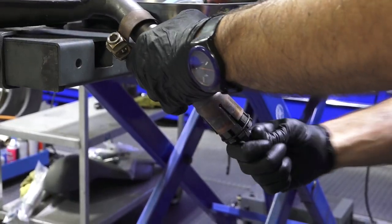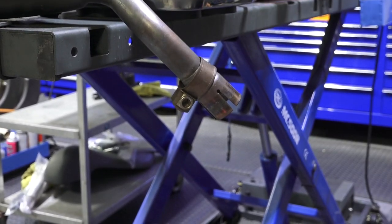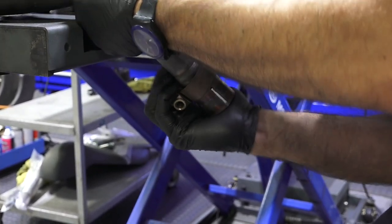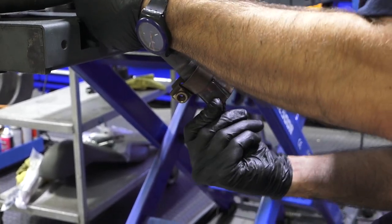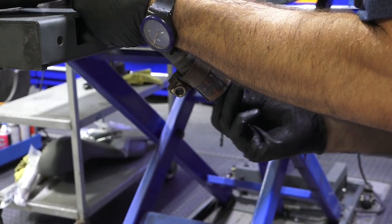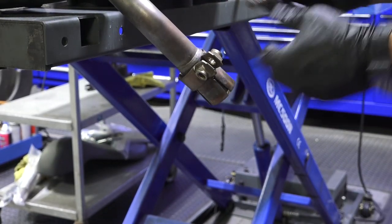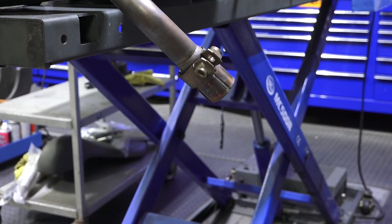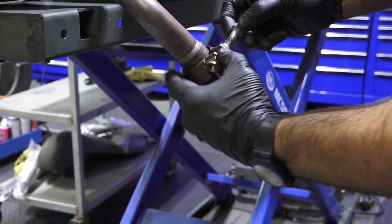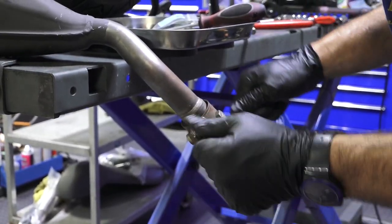So the exhaust expander, the newer style bushings have that kind of stuff on the end. And a lot of times, if you expand it just perfectly, you could just use your fingers to push it in there, so. A lot of times, even before I put this all together, put some anti-seize, I'll make sure this threads in. These clamps sometimes, there's been ones that we've had to cut off because they've seized up. So I'll get the screw in there.